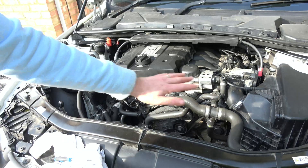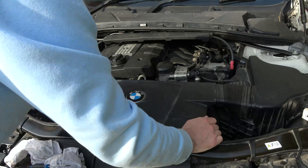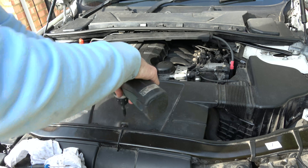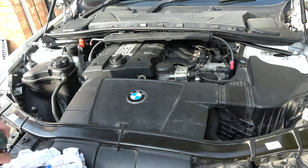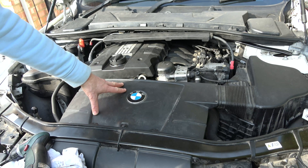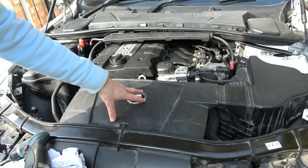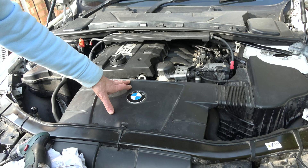Now we just need to put the cover back on — place it in here, get it into the rough position, get the hose on, and you can see it's seated nicely. Do up the three screws — you're only going into plastic so just nip them up. There you go, job done. Hopefully if you've got a problem with your sensor that will have fixed it. Nice and easy to get to, nice and easy to take out, and easy to test as well. If you enjoyed the video give it a big thumbs up. Remember, just because it's testing okay like that it doesn't mean it's definitely okay — but if you're not getting any reading from it, there's a good chance the sensor is faulty. Thanks for watching.